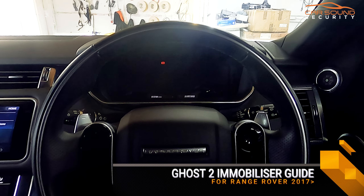Service mode is for garage use or valet only. Do this when you get to the garage or valet area — do not put the Ghost 2 into service mode before you get there. The Ghost system will reactivate if you drive at 30 miles per hour or more, or after 10 minutes. So stop the vehicle and next time you will have to enter the code. It's only meant for a very small area of driving and not meant to be driven at a constant speed of about 30 miles an hour.